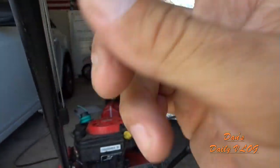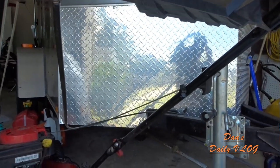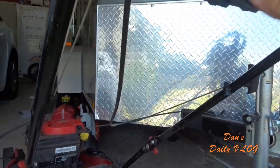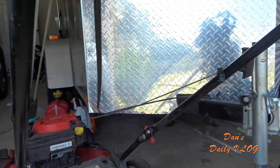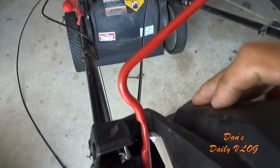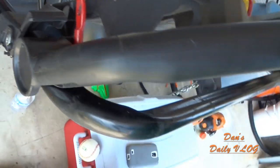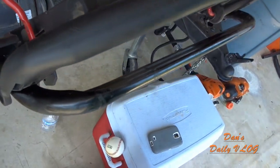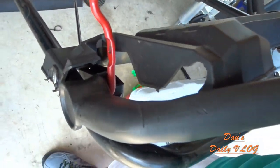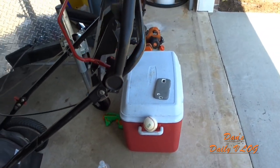You have another one of those squeeze points right here, so you gotta get to that from the inside. To get to the inside, just pop this out of your way here. That's just some decorative cover — I don't even know why this is here, honestly. I hate all this crap they put on mowers. But right in there is how you get to it, so you gotta take this off. You take this bolt out and then you can get to the cable. Let me get that bolt out and show you the right way.